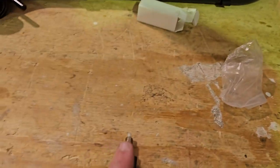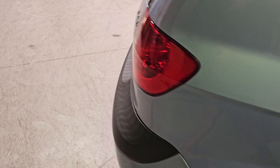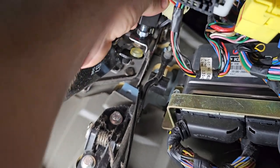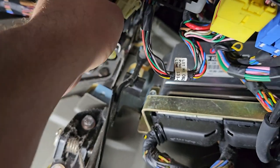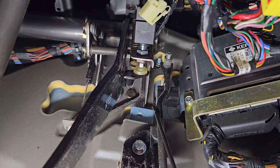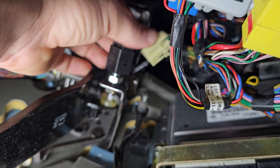Come back over to your workbench — old and new. Let's go throw the new one in. Sometimes they will require adjustment. Basically, you adjust this screw here and then tighten it up by hand. That way, if it's all in the right position and you haven't got your foot on the brake, then the lights won't be on. Screwing it back in in the same fashion as we unscrewed it. You can see just there how, when the brake pedal isn't depressed, that white tag is hardly being pushed in — so let's adjust it a little bit more. You can back off that bolt there and then continue to screw it in.